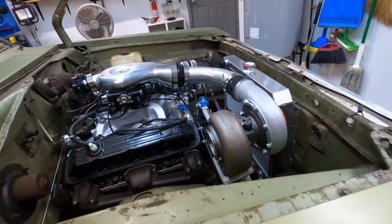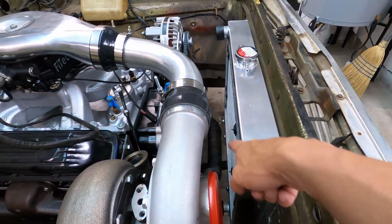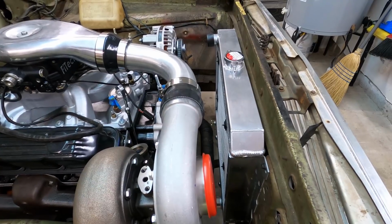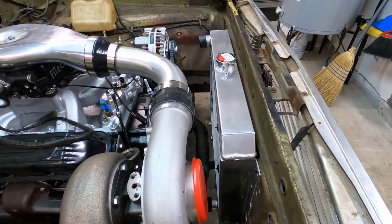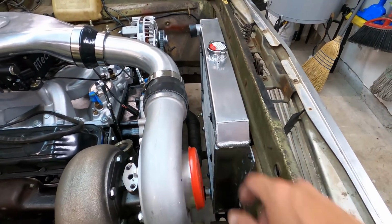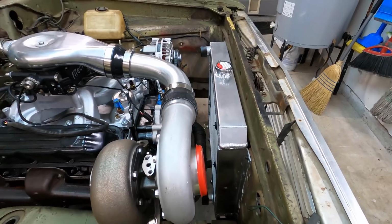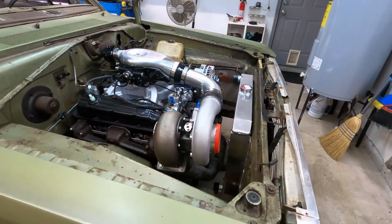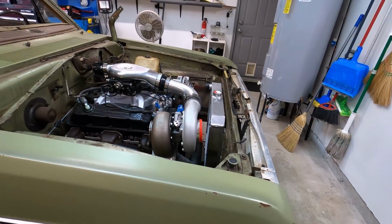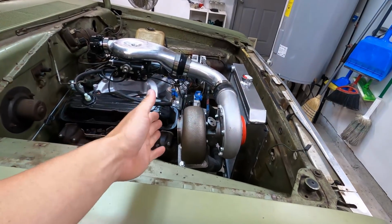And also I gotta pull the transmission cooler plugs out of the bottom of the radiator, because those will definitely melt. And I'm hoping that the crossover pipe won't get hot enough to melt the radiator, because it's aluminum. Might have to put a heat shield in between it, just kind of divide it out there. But that is going to do it for today. I wanted to see this stuff so I can get a better idea of the downpipe. That's going to be next.